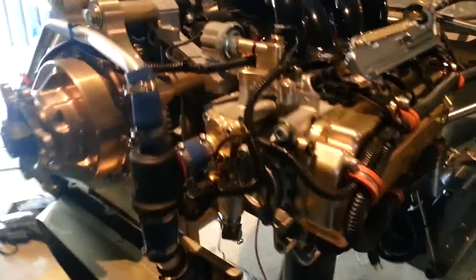We've got a beautiful installation here with the most minor of things to look at. We inspected the cowling and saw just a tiny bit of contact in a few spots, and also a little bit of chafing in the top cowling. These are things to be aware of — the engine should not touch the cowling anywhere, because the engine is rubber mounted, so any metal-to-cowling contact will transmit vibration into the airplane.